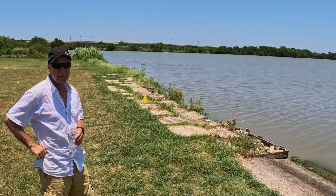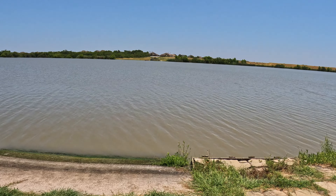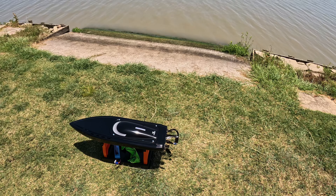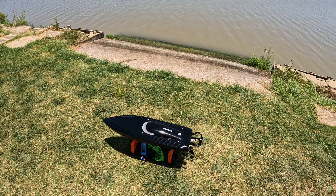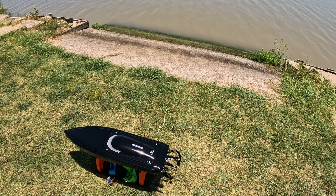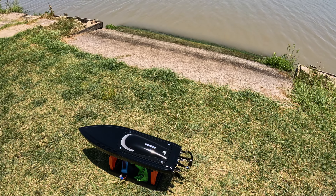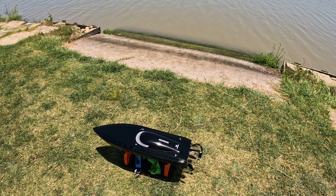That's a long walk — about 20 minutes. Same Pro Boat Sonic Wake V2. Stripped all the stickers off, polished it, didn't blueprint the bottom, didn't sand the bottom — nice polish. Took the trim tabs off per Ironclad RC, leveled them with the bottom of the boat, which is about a six millimeter difference between the original trim tab position and how they are now.